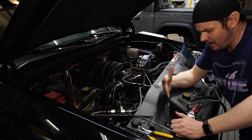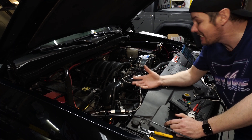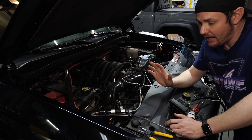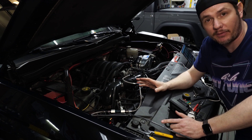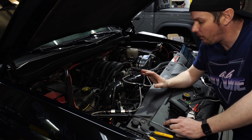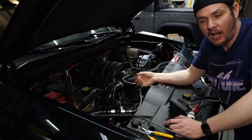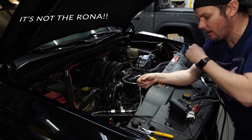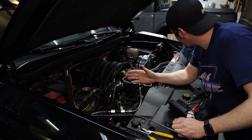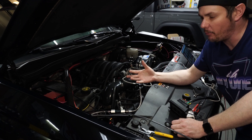The other thing I've noticed is that the boost control appears to be all duty cycle related. I didn't see any pressure-based tables on there. So if you know anything about using a mega squirt or micro squirt for boost control, let me know. Basically, I want to reach a certain pressure and then start pulsing the solenoid to let the bypass valve start to open at that pressure.